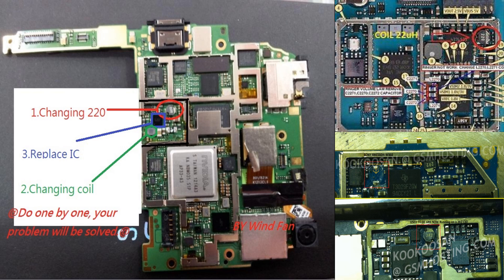Now I want to show you how to fix the LCD backlight problem after purchasing the wrong unit or if it just went off. Here on the left side you can see an HTC One X mainboard and three main components responsible for the LCD backlight. The first is a 220 coil, the second is another coil, and the third is an IC which regulates the LCD backlight. The first thing you should do is change the 220 coil. If that doesn't work, change the other coil. If it still doesn't work, replace the IC. But in 90% of cases you have just burned your 220 coil. You can find 220 coils in old phones — an old Nokia contains one, and an old Sony Ericsson contains two.